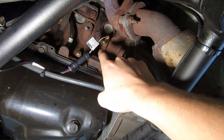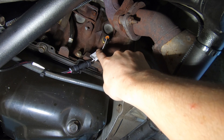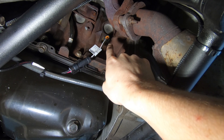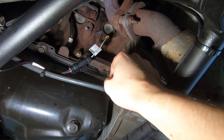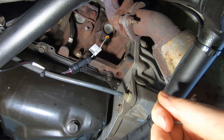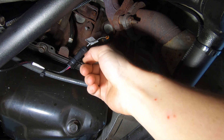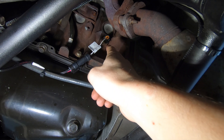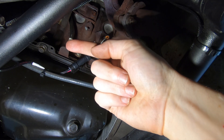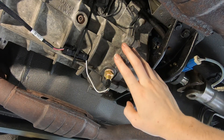Over on the driver's side, this is where I'm pulling my coolant temperature information. The factory had a blank block drain plug here in 3/8 NPT, so all I did was pull out the block drain and thread in a 3/8 NPT sensor — it threaded right in. Now I have coolant temp information in addition to all my oil pressure information up front.